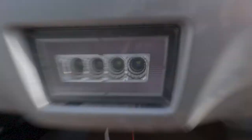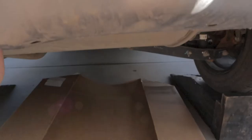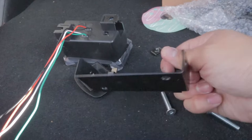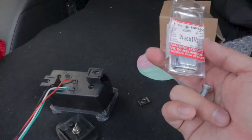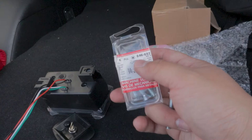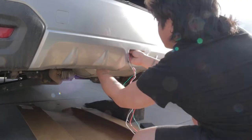Before installing, you want to remove the two screws in the back plate, because this is how you're going to secure the fourth brake light into that slot. This light is meant for a WRX or STI — you can see it fits the shape — but there's a little notch that makes it look like it doesn't fit, plus that back piece doesn't exist on WRX STIs. The problem is the screws holding the back plate are too short, so we're going to use longer machine screws from Home Depot. These are 1/4-20 by 1.5 inch — basically the same thread, just longer with a different head.